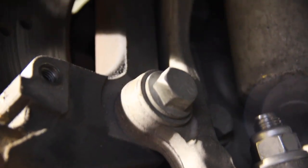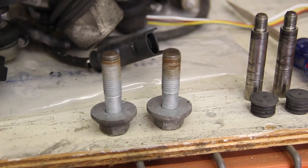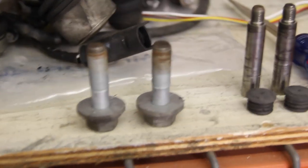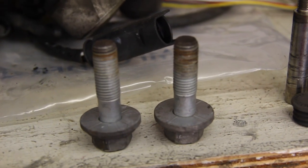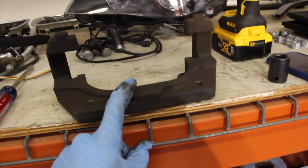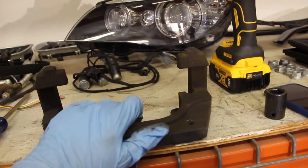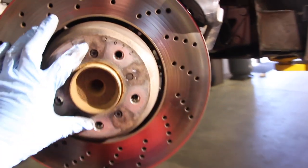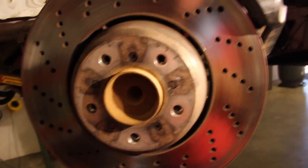If we look at the back side and crawl under the car, there are just two big bolts holding the carrier in - one there and one up in the center. The two caliper carrier bolts are 18mm. They're down pretty tight; if you can get an impact gun in there, that's great. I was able to do the bottom one with an impact and the top one by hand with the breaker bar, no problem. Once those bolts are loose, this thing will fall right out, so have a hand ready to catch it. With that out of the way, there's nothing else holding on our rotor now but those two set screws.